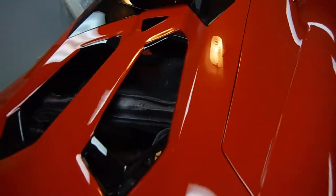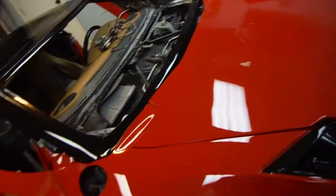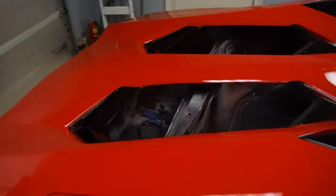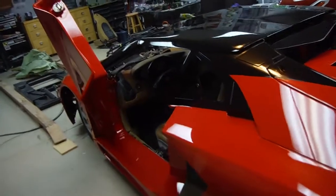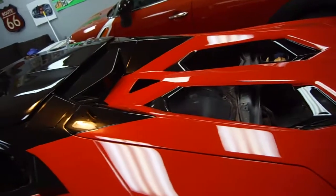I noticed one of the struts on this back hatch is wearing out. I don't know if it's dust, but it was a year in the garage with me working on it and all the things were fine. It seems like when you take them to the body shop, the struts for the doors and trunk lid and all that get dust in them and then they seem to leak that seal or something. I had to buy 2 new ones, one for the driver's door and one for the passenger door, and those are not cheap. They were $40-some apiece because they're really long. And like I said, one of these is going bad, or they're both going bad, because this won't stay up. It holds a little bit, but I don't mind. These ones are short and probably $10-15, nothing.